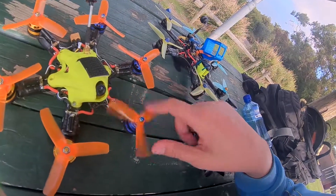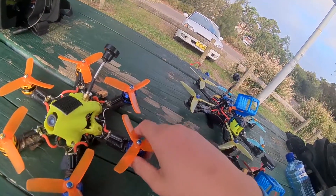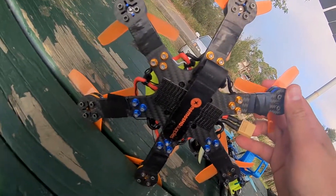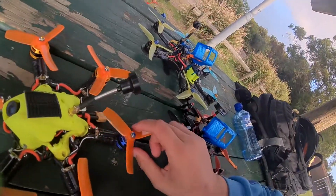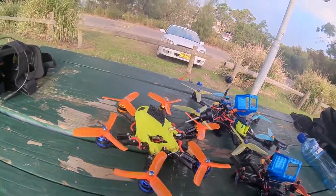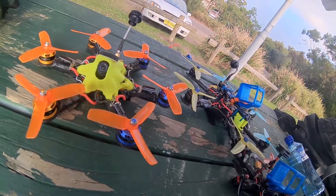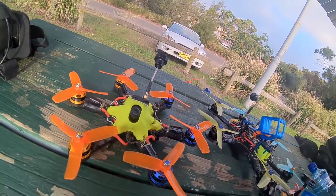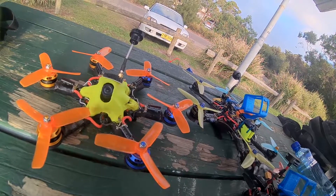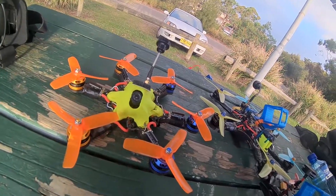Back to the 4-inch — it's a pretty basic build. You've got to wrap the wires oddly to match the pod, and it's all held down by M3 nylon lock nuts. These motors get warm on 6S when you're really throttling it, but they handle it. I suspect it's to do with the air gap that they accidentally put in them, which is usually what you don't want with a motor — it takes away from torque, cogging, and its ability to really spin up and make power.